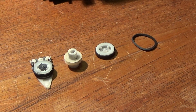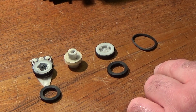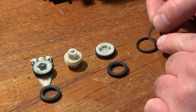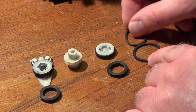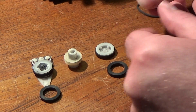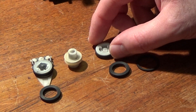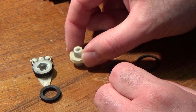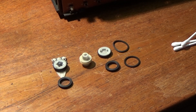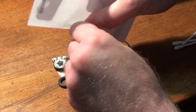Let's have a look in the belt kit and see if we can identify the two idler tyres. They look both exactly the same, so it's fairly obvious which those are. Now which belt do we want here? That one looks a little bit too small. Let's try the next size up — that one looks slightly too big to me. So given that this one has probably stretched, I'm going to say the smallest belt out of this kit is the right one for there. I will give this pulley a little bit of a clean and try to clean the motor spindle inside the deck as well. That's better.